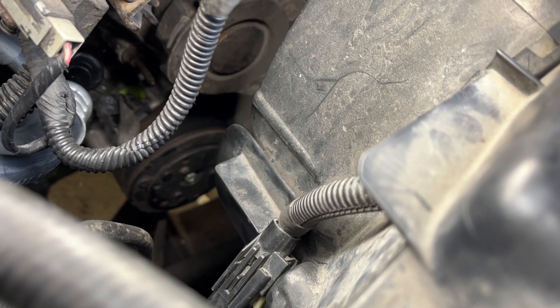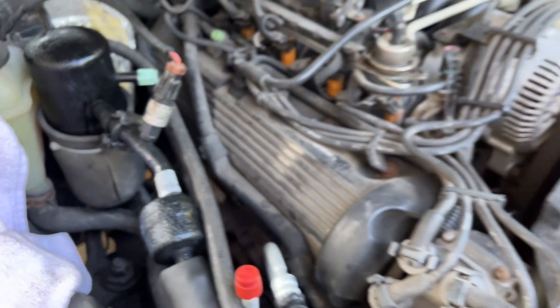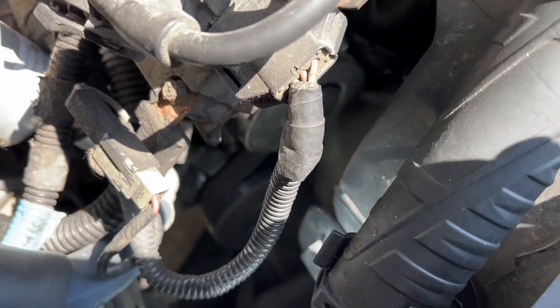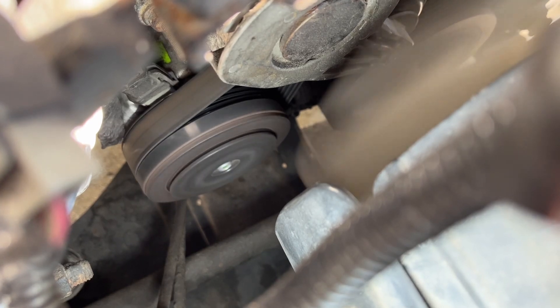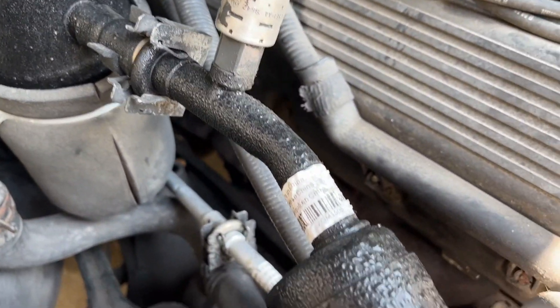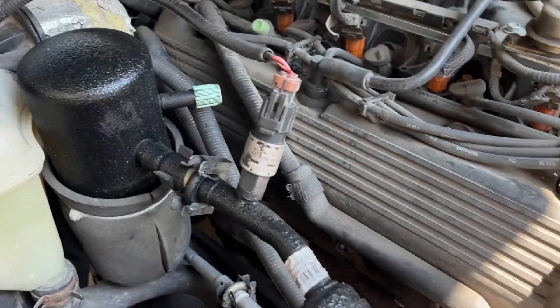The freon is back in and there's a shot of the compressor — it's definitely running and we're definitely getting cooling. You can see some condensation on the suction side. The real question is whether the leak has been found, which will take a few days or a week to confirm. We're back five weeks after filling the freon. The compressor is running pretty continuously, which tells us we still have freon, so the repair was successful — at least there's no fast leak like last time when it leaked out in about two weeks. The air conditioning is working really well; the return line has condensation all over it and inside the car is nice and cool.